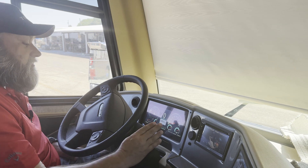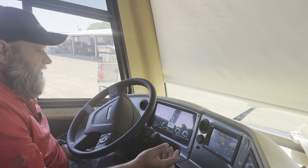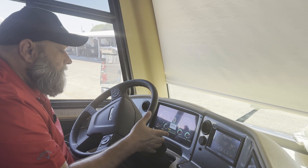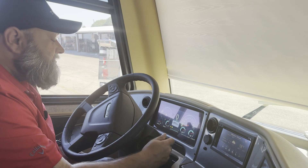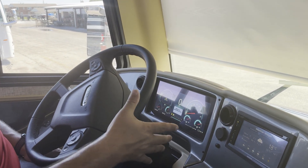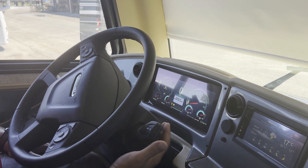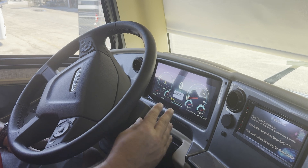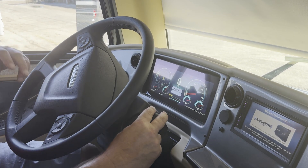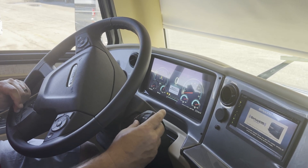On your Freightliner, it's all done in the same shift. What you would do — of course you're going to have it in drive — and if you push it, you'll see it goes into M1 for manual one. At that point, it's a paddle shift. Pull it back to change gears and you can drive the same automatic just like a manual to help use the engine and the coach to slow down and not get too fast coming down the side of the mountain.